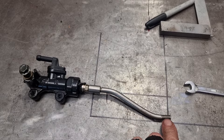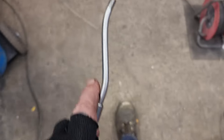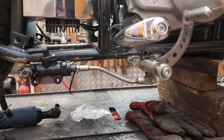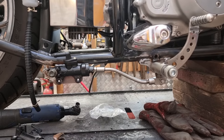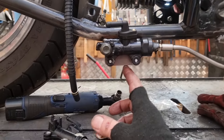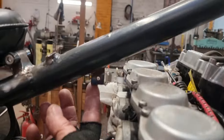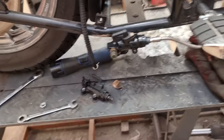With that made and everything screwed together, a little tweak on the end to get it all to the right length — I reckon that is good to go. We'll get it screwed onto this clevis. I don't think we'll be a mile off. There you go — a nice firm action on the back brake. I think everything there is absolutely spot on. I think that'll work lovely. I've used this bracket as it is — I thought about shaping it but you know these really well on a custom. Everything was done on a bracket like that, with a bit of square tube and a hole in it, so I wanted to keep it in keeping.